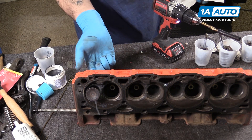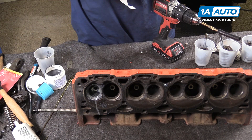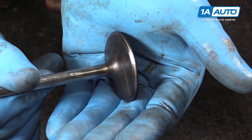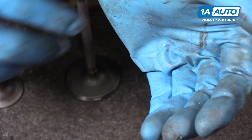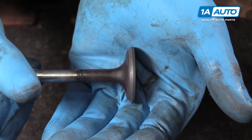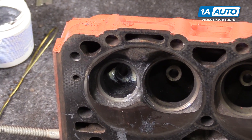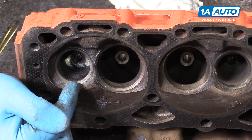There's always a faster way of doing this — coat the valve stem in grease, get some more valve grinding compound on the seat and the valve, and in our case we'll be using a drill bit and a piece of rubber hose. Slide the rubber hose over the drill bit and the end of the valve stem, then run it with the drill and tap it up and down while you do this. Add compound as necessary — don't use too much with this method because you'll just send it flying everywhere. Occasionally remove the hose and the valve, clean it off, and take a look at your cut. On our cut valve, while we do still have some minor pitting to clean up, you can distinctly see the three cuts. We'll repeat this process on all of our valves.